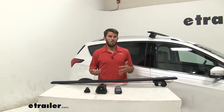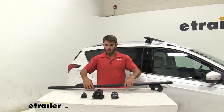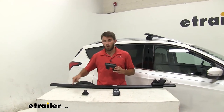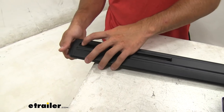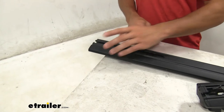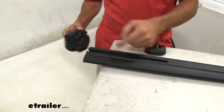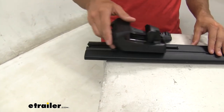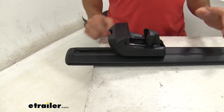It's going to be very easy to assemble — we've got our front one installed right now and the rear one goes up the exact same way. With these raised rail bars, all we have to do is get our raised rail foot into our wing bar. First, remove the end cap by pushing down on that tab and pulling it off. Then the tab on our raised rail foot goes into the channel just like that. Then we put our end cap back on and we're ready to get it on our roof.